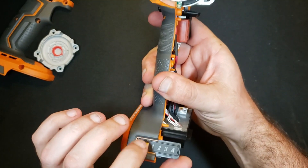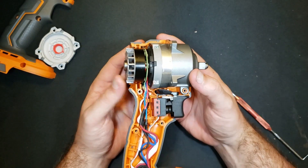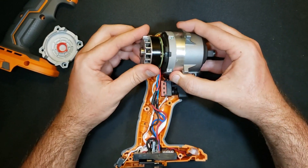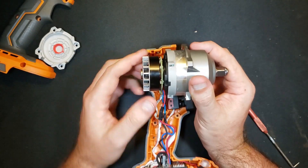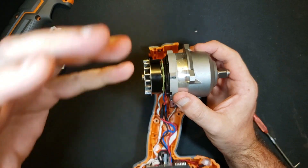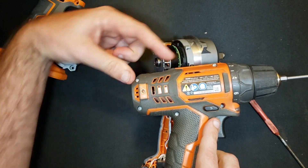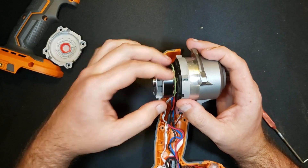A new feature these have is modes, and that's probably because brushless motors are inherently programmable — you have to have programming to run a brushless motor, you can't just attach it to a battery. You can see that circuit board right there, because you have to have a circuit board to run a brushless motor. Goodness gracious, look how tiny that is — that's the whole motor, guys. This black right here is the entire motor. That's how much power density they fit. Look at this compared to a 12-volt — the motor is that big. That is the power of technology right there.